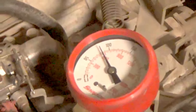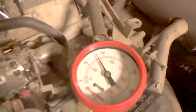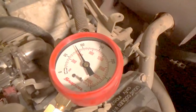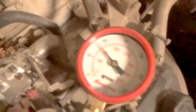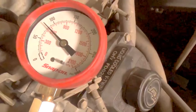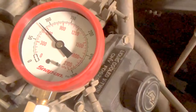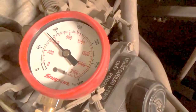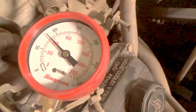You may have heard that grinding noise as it was cranking. If you noticed, we shot up pretty much right away to about 75 to 80 PSI, but nothing past that — an immediate pressure rise and then nothing.